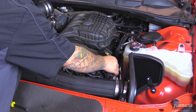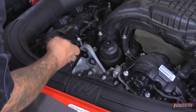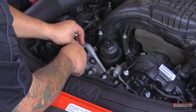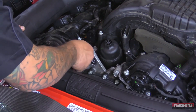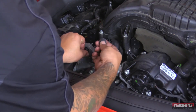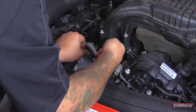Rotate it and push it on to the throttle body side. Then bolt up the intake tube mounting bracket to the engine. There's another supplied weld nut — push it into this hole. Push the bracket up and with the supplied hardware stick the bolt through the bracket and through the weld nut and screw it in. Then put the rubber washer on — it comes supplied in the kit — then a flat washer, and then a nut.